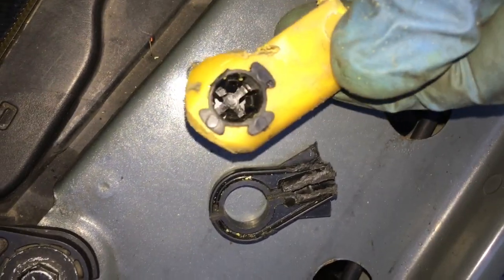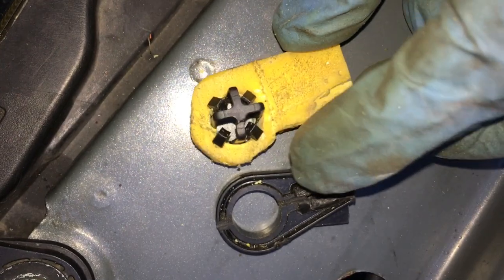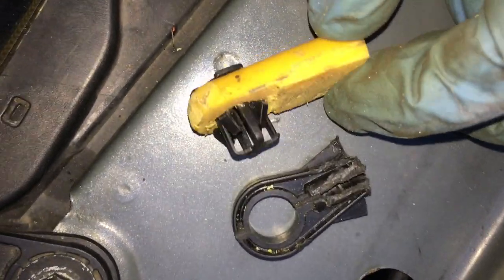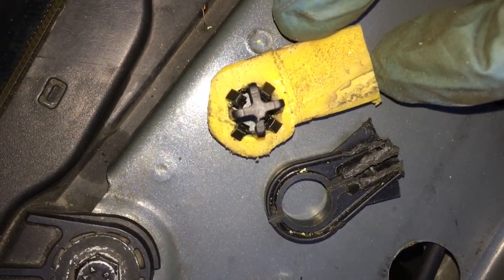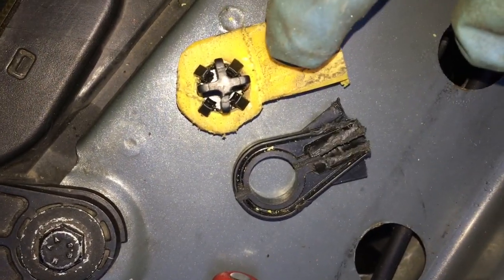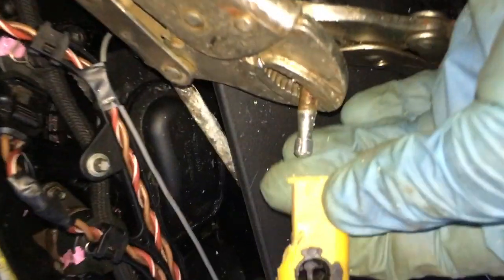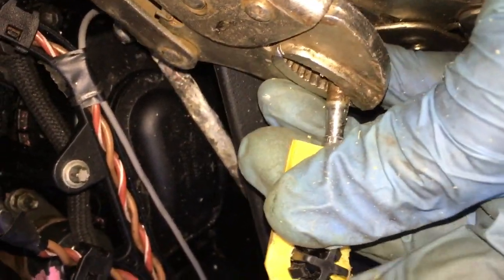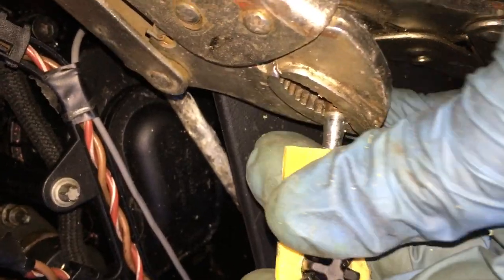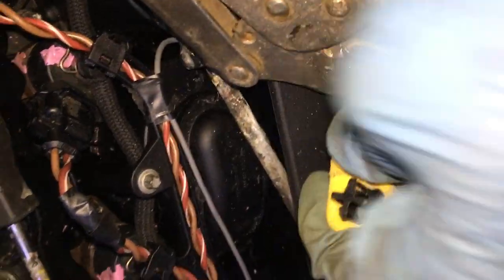There's our new piece of plastic - doesn't look that pretty. I've got the original plastic clip inside the hole which fits okay, testing the width and hole diameter. You can see where the pedal's going to be - it's about another 5mm further away. The end of our master cylinder fits snugly on there - that's a nice tight fit. That's a 6.5mm hole.